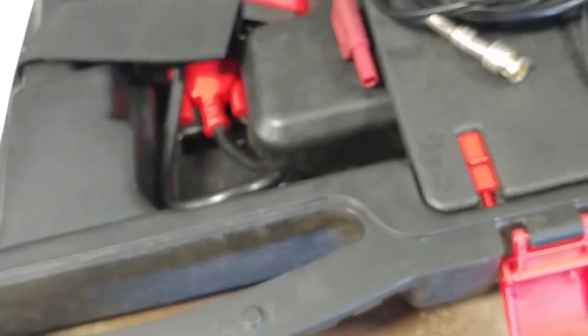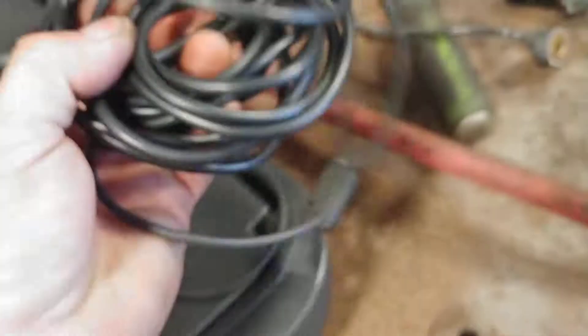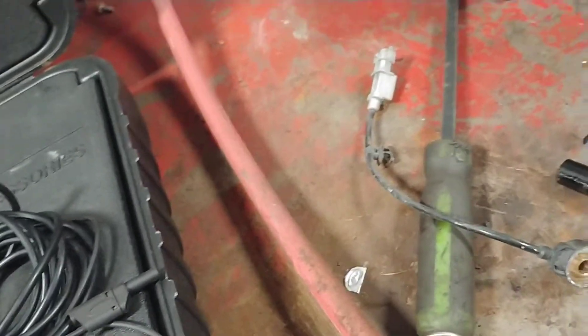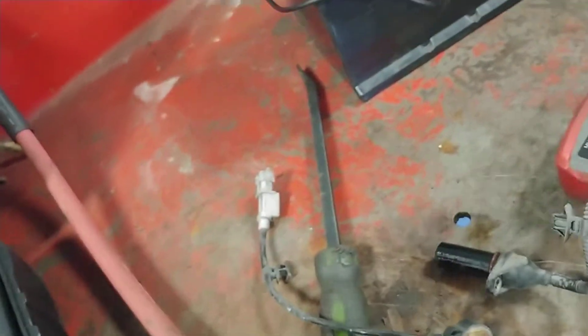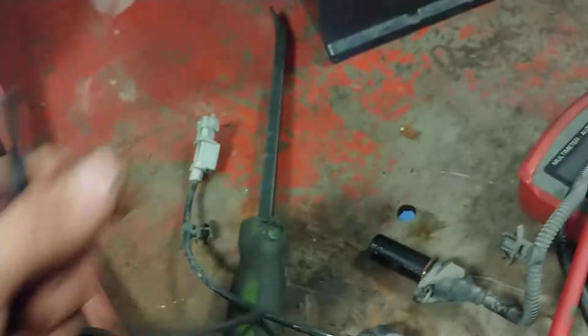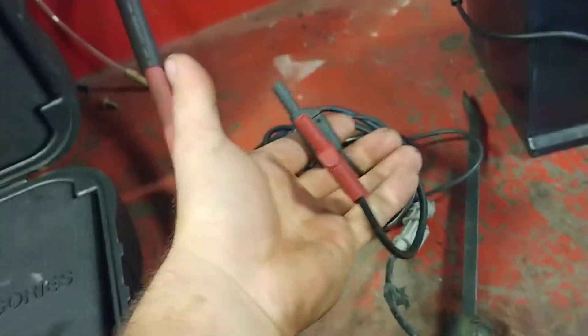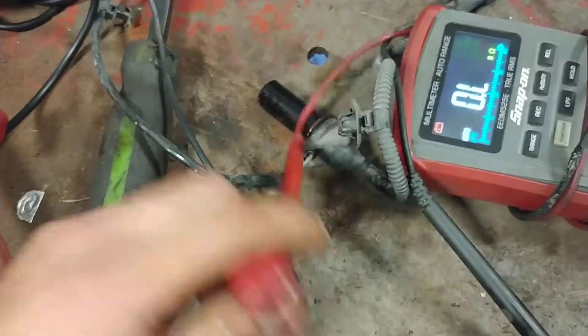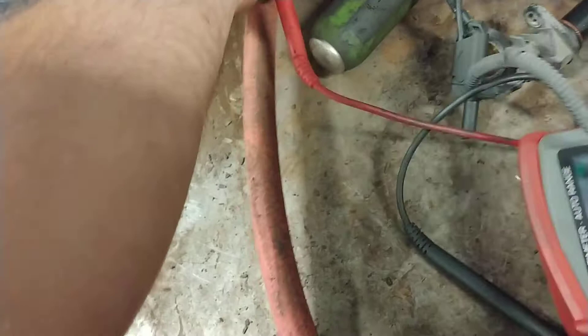Because I couldn't use my scope. So the issue is that the cables themselves actually short out together, and I will show you that. So here's one cable right here - we're going to take and go on to resistance, we're going to take and hook this lead up to this one.